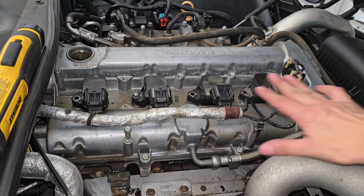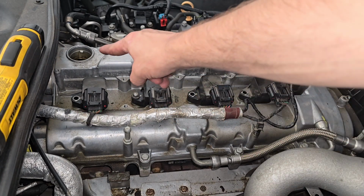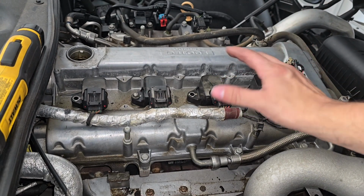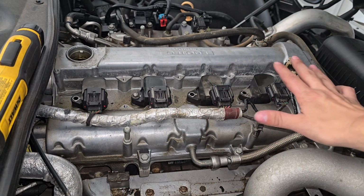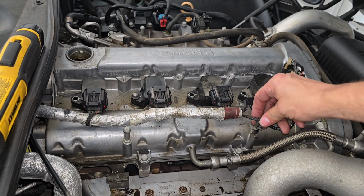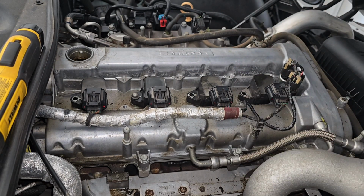4. Now that all those are clicked on, take your engine cover and pop it back on, and don't forget your oil cap as well. You have to put the oil cap on after your insulation has been reinstalled. Once all that is complete, reapply the clips for your turbo hose if you have the turbo. Make sure to take your Christmas tree down here and install that as well. Then you can put your engine cover on, and you have completed this procedure.